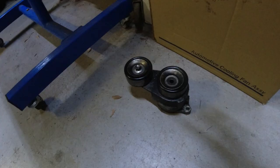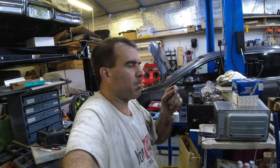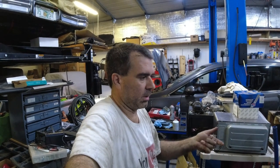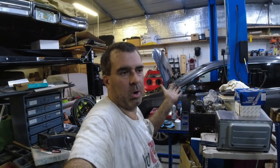It was something I needed to do while I'm in there with everything apart. I forgot there was a little washer on the other side against the block, and when I started it up the first time the belt skipped over like it was coming off the pulley. I had to pull the tensioner off and redo it. Anyway, it's working good now — the belt is staying on there. That's how you do the idler on a 2014 Honda Odyssey. I did cheat a little because the AC and alternator aren't there, but if you're doing the AC compressor, you might as well just change this thing while all that stuff's out of the way. Thanks for watching — catch you in the next video.